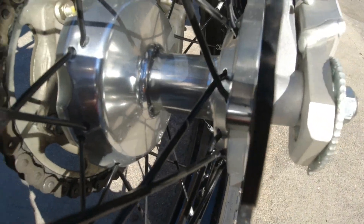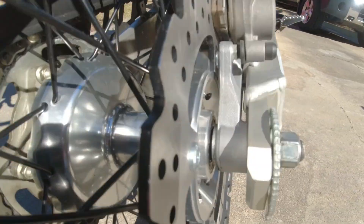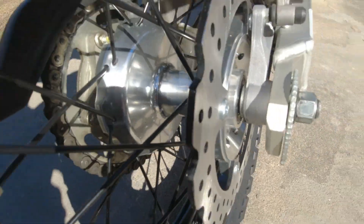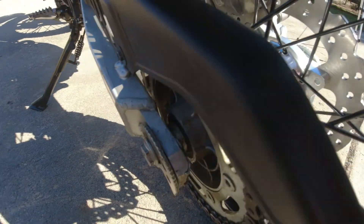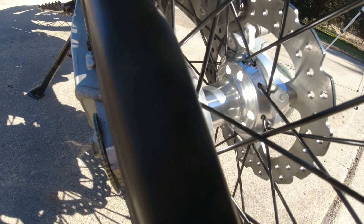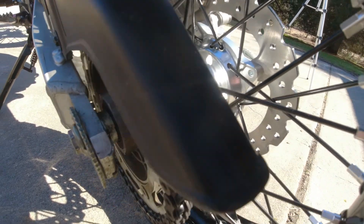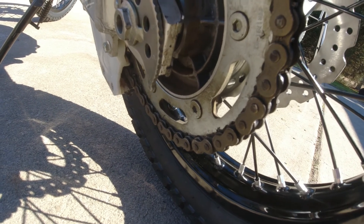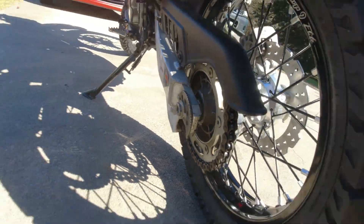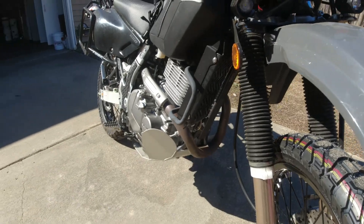Since I have a gray and black bike, I went with black spokes and chrome nipples. And also, if you look at this hub — hopefully you can see this — it's all machined. It's their special hub that they make for the Warp 9 wheels, or actually it's for the DR, but they come with the wheels. You can use your stock cush drive system to include your sprockets. So basically, when you take the wheel off, you just use part of the stock components.